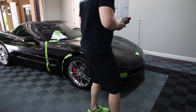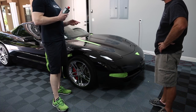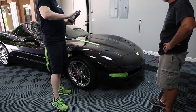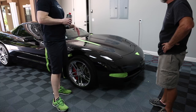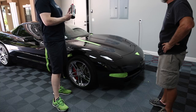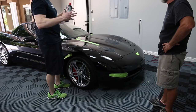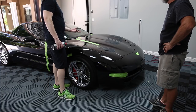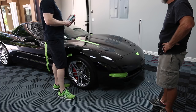Normally, most of these modern cars, they don't wet sand them anymore. But if you went to a body shop and they painted the car, the clear coat's all globby, so then they wet sand it to really bring out the shine. Wet sanding would make this super dull, so you'd use like a 1200 grit and then a 3000 grit, and then you would use a compound. What they'd usually use is a rotary buffer, like what you see with a big wool pad on it, and then you would do a dual action polisher and finish it out with a finishing polish.